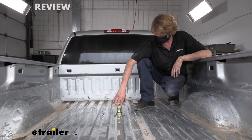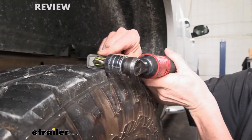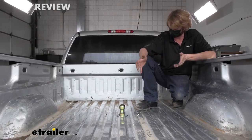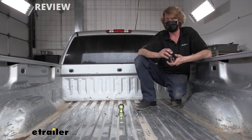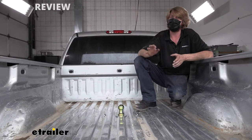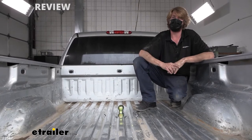One of the things I did not like about this kit was the handle nuts that came included. I did have some difficulty getting those bolts to torque down because they wanted to slip on the inside. We had to remove those and get them back right to get them to work. So pay attention to those handle nuts. There is a blurb in the instructions about preparing those — definitely follow that to a T, and it might not hurt to ensure those tangs are holding that bolt properly.